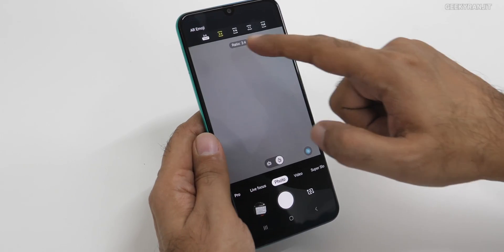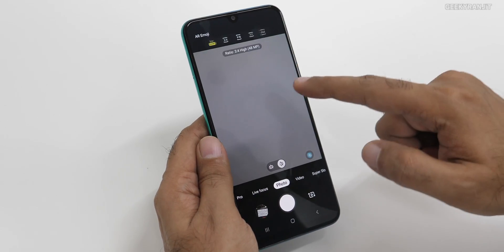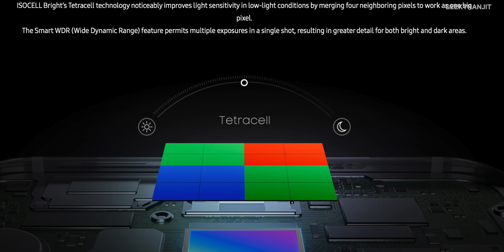So you're essentially doing pixel binning - does that mean it becomes a 12 megapixel image? No, this is not like the older sensor versions that did software enhancement by pixel binning upwards. It's a true 48 megapixel resolution camera. In daytime, when you're taking pictures in 48 megapixel mode, you're getting true resolution 48 megapixel images. It's only in low light conditions that Tetra Cell technology comes into play, and it moves automatically at the back end into a 12 megapixel camera with super pixels to absorb more light - including in night mode.